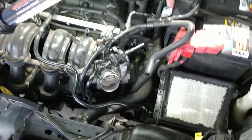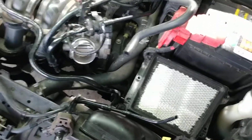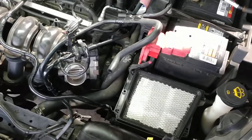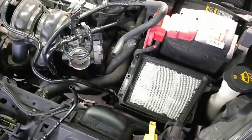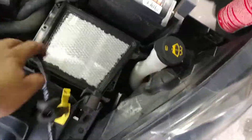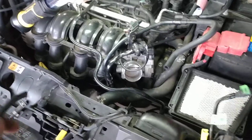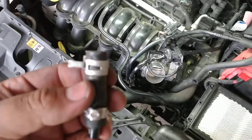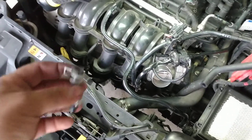The install is the reversal of what I just said. I would try putting that hose under there first — you should be able to slide it right in. You can use a little dab of fresh oil or some saliva even, move it up and slide it in. Just make sure you place that little clamp about that far in.